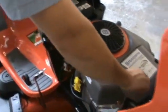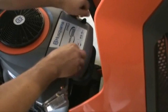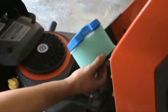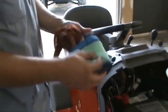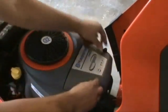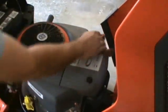While you're here, take a look at the air filter itself. On this particular one it's very simple. Pull these two pins out from the top, lift off the air filter shroud, and just grab the air filter and pull it up. You may find you have an oiled filter or a regular disposable one like this — it's a pre-filter and then the actual filter inside. Once you get your new one, put it back and install your pre-filter over the top, snap it down, reinstall your cover, and re-tighten it. That takes care of your tune-up — an oil change and the air filter.